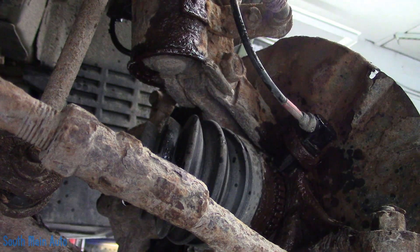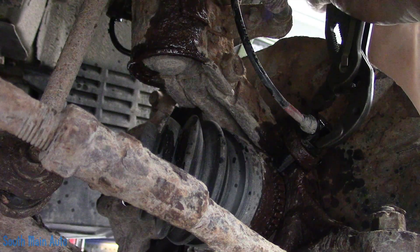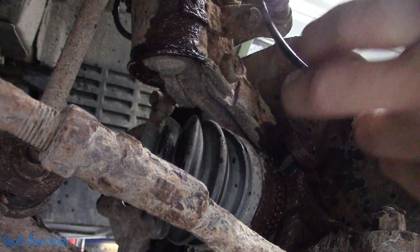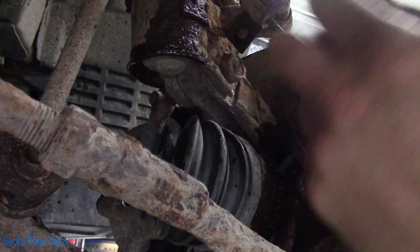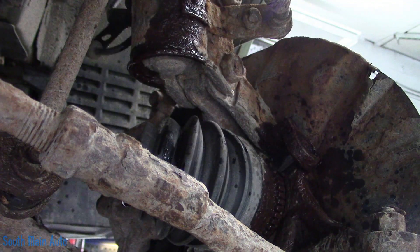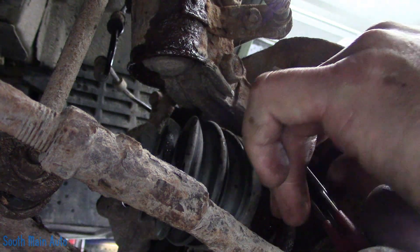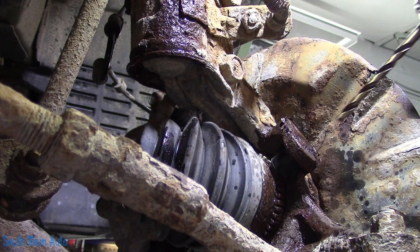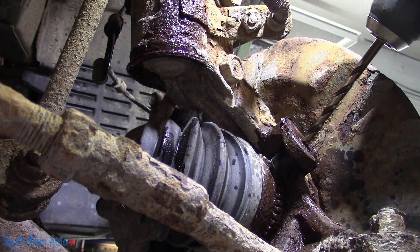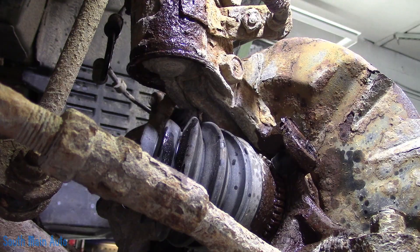Not really. Well, we all get excited. See, fella? That's why this speed sensor didn't work — this sucker's all rusted in the middle. You see that, where the sensor typically goes? That is why we can't drive it down, and I don't want to pull the axle. So what we'll do is we'll whittle it out from the top with the drill. We'll just whittle away the plastic bits here. Wow, that's a really strong magnet. There we go — get something smaller. We're going to whittle the plastic; we should be able to get it to come out.